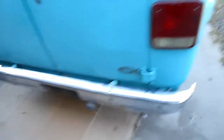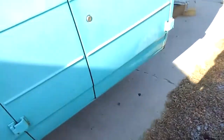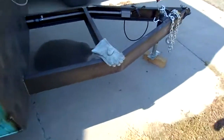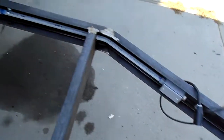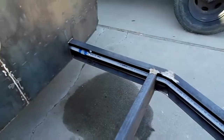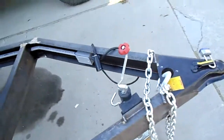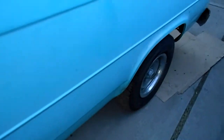Why go to all the trouble with PVC and conduit and stuff? Well, I just tend to be a little anal about these things. I really hate the way trailer manufacturers just weld washers to the bottom of their frame, run wires through that, and expect it to last. It's pretty ridiculous. So with this I shouldn't ever have any electrical issues — provided that the vehicle it hooks up to doesn't have any issues — but my wiring is rock solid, 100% sealed up.